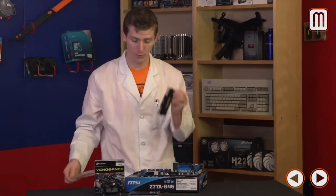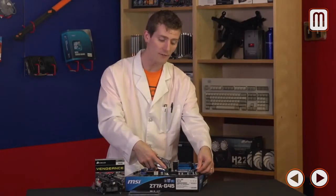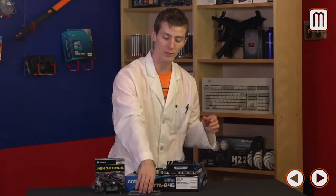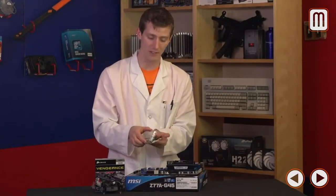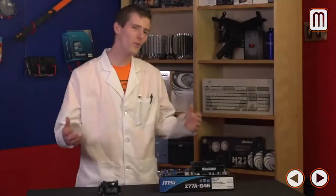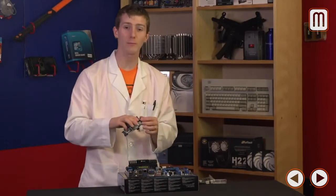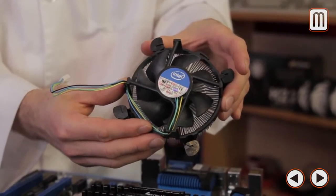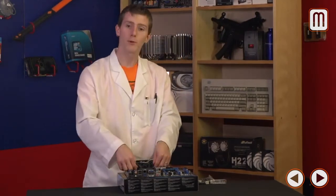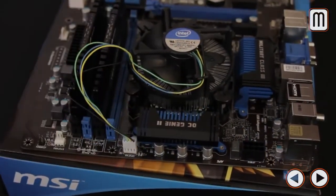To make use of dual-channel memory, take your two memory sticks and install them in the color-coded memory slots by pushing down firmly on both sides after opening the tabs. I personally prefer to install them in the slots furthest from the CPU socket — however, since we're using a liquid cooler we don't have any clearance issues. We'll need the stock heatsink for the out-of-case testing. The pins are already in the correct position; just make sure you have enough cable length on the four-pin connector to reach the CPU fan header. Push the pins down in a cross pattern and wait for the click, then plug it in.